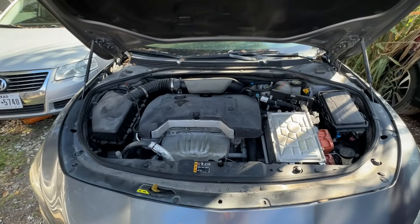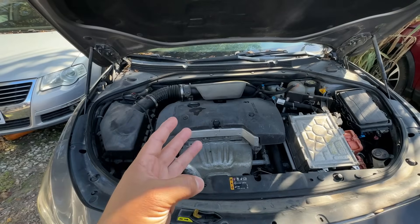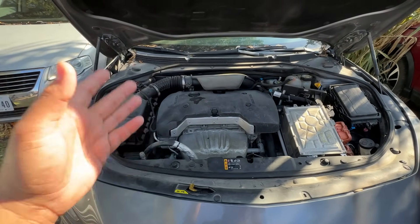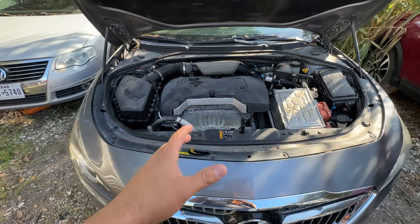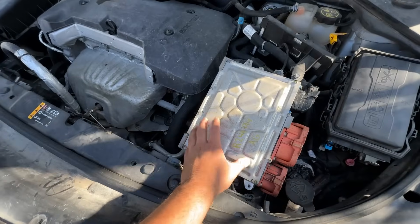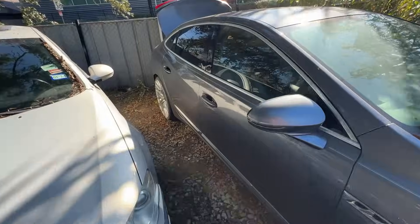This does make the vehicle much more complicated, especially when it comes to diagnosing electronics. The reason we're here is because the vehicle is not charging. According to the mechanic, they actually replaced the alternator slash generator slash motor three different times. They put used parts on it from the salvage yard because the customer couldn't afford a new one. Even after replacing the generator motor, the charging system still wasn't working, so they also replaced the controller for the generator.